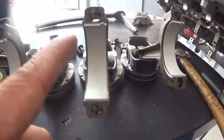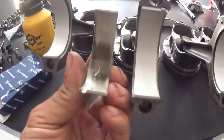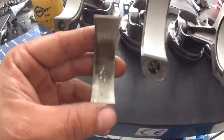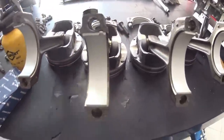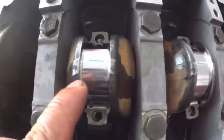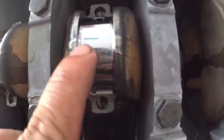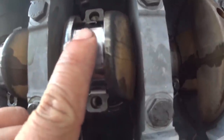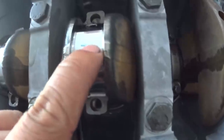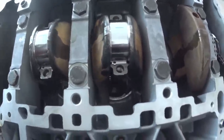Done — rings placed, bronzinas placed. Look at the color of this bronzina — how beautiful it is — and look at the color the old bronzina was. All its coating is gone. A remapped car is like this — everything extra power you extract, something takes the hit. Now the pistons are placed, I cut the plastic gauge here and here. We are going to position it a bit more toward the center. Then we put the connecting rod caps, torque them and see what the measurement is. Done — we already pressed the plastic gauge. Roger, what is the measurement on the torque spec sheet? It's 0.025 to 0.071.